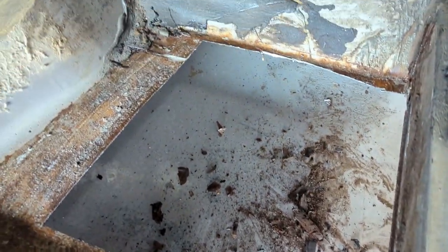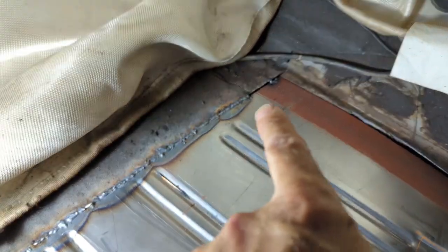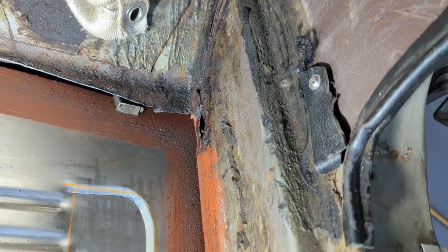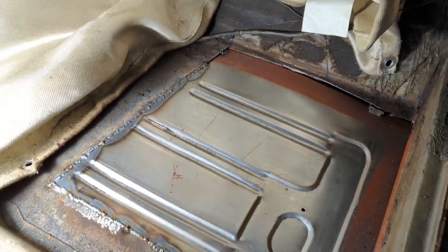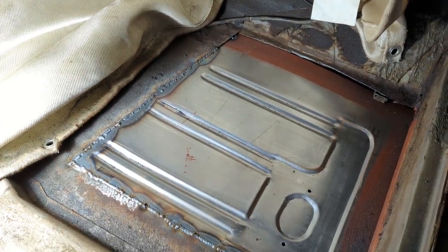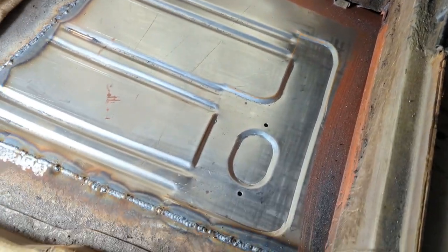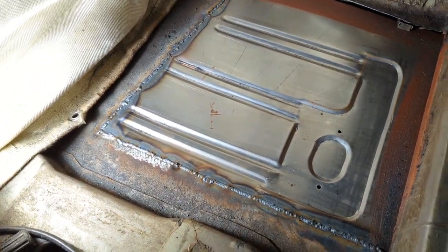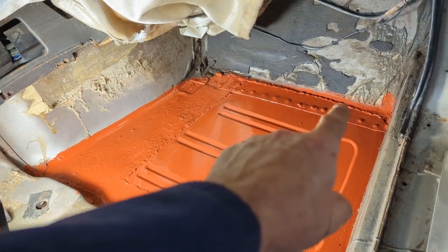She's coming along quite nicely. I've got the top welded most of the way around. I'll go underneath and weld that little gap, and this section needs a piece put in. I found a hole right here that had some seam sealer on it, so I'll patch that up — small job, no big deal. Then it has to be welded up from the bottom and it should be a solid floor again. I'll put seam sealer everywhere I weld, and I'll do a pass of thin seam sealer over the old welds once it's been primed.